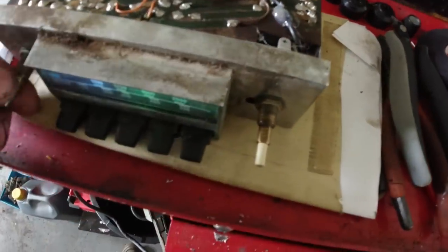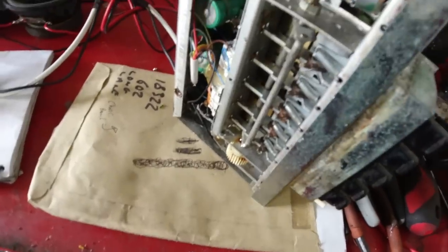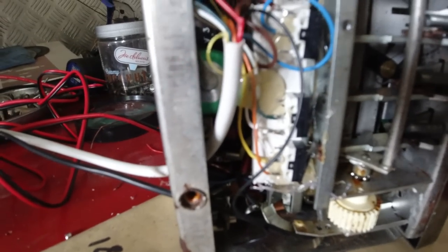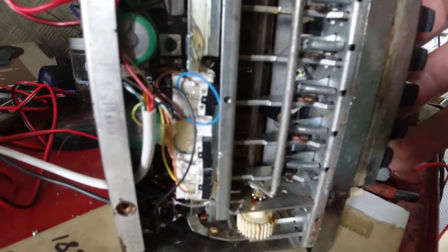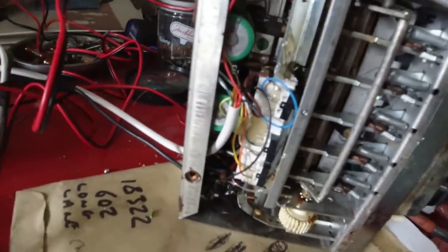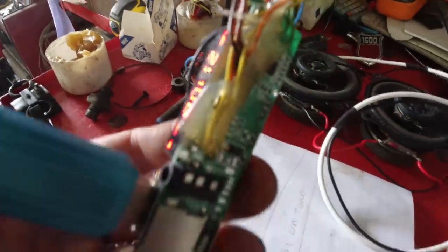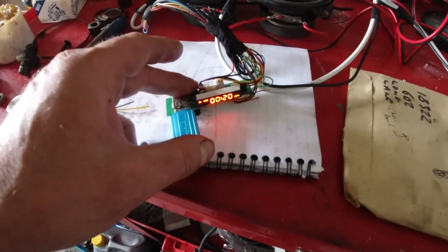You get volume control from the amplifier, which is now repaired on the set itself. That's the whole affair and it's going to go in to Papa. On the back I've fitted these micro switches. The rods which you press - normally these would have been for preset stations - hit the micro switches: rewind, forward and mode. They just parallel or piggyback across the switches on board, you just solder them across.